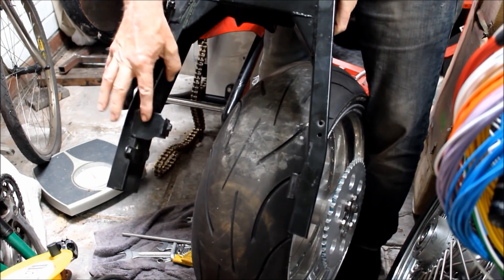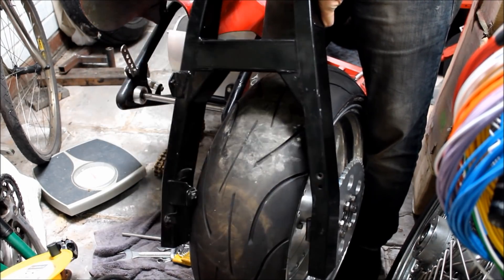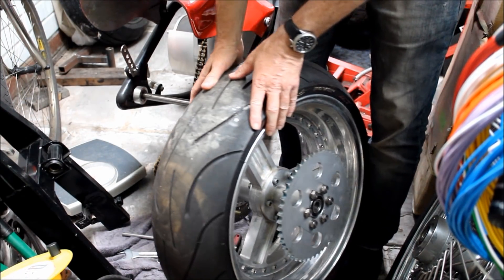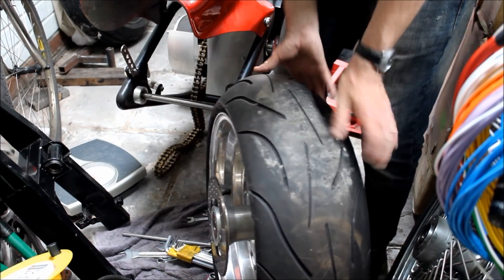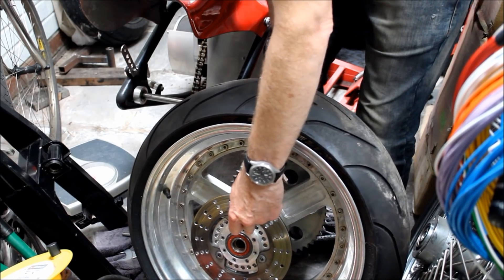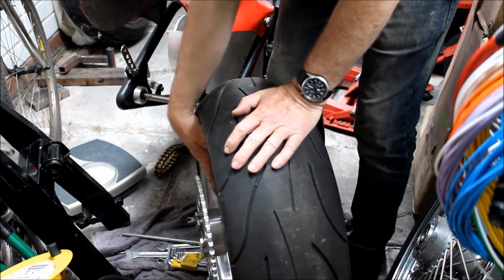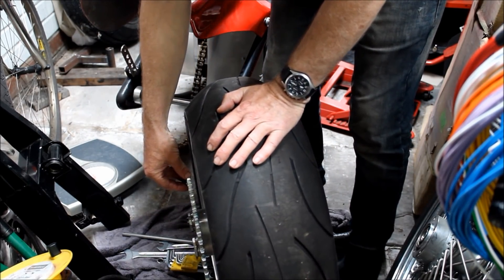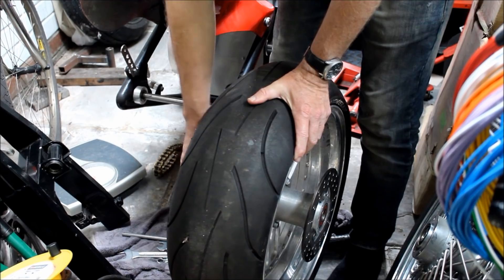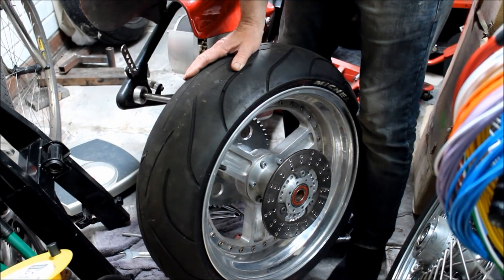So this boss is going to have to go, as is that one there, and even then it's going to be quite a tight fit. But it might not be a problem because this wheel is a composite wheel — the hubs are bolted to the centres, and these hubs can be reduced down in size; they can be machined down a bit. On this side, this section here can be machined down by quite a lot if need be. We need to make sure we've got clearance for the chain, but there's still a good 10mm there that we can take off. So although it might be a close call, I think this wheel will fit in that swingarm with some mods — which is a good thing.